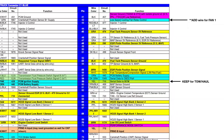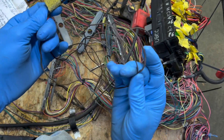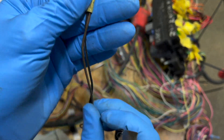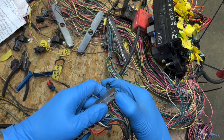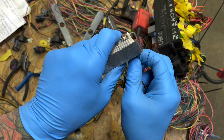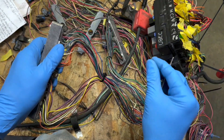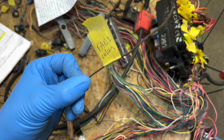Since I'm running an electric fan, I need to add a wire to pin 42 on the blue connector. I'll use a wire I removed — this long brown one that goes to the oil level sensor looks pretty good. Snip it up close, and now we've got a long wire to install. These connectors have little weatherproof seals, so you'll need to poke a hole through with a long needle or sharp nail. Make sure to note in your notes that this is a brown wire for fan one control, then label the wire and coil it up.